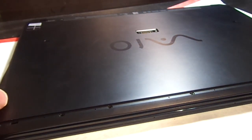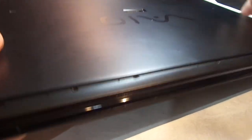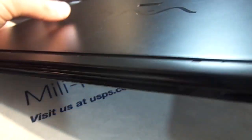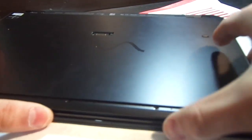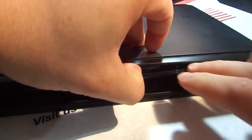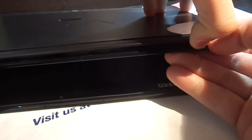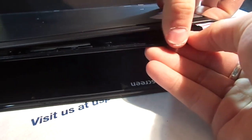After you've got all the screws removed, the next step is simply to pry off the cover. To do that, start on the side opposite the ports, as they'll make it difficult to pull off — so start on the power side. It may be easiest to actually start in the middle and then work out to the power side. Just use a fingernail and move along the side until it's all pried up, then delicately but forcefully work out the corner until you can pull the whole thing apart.